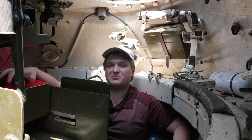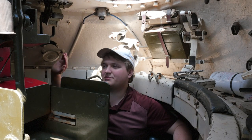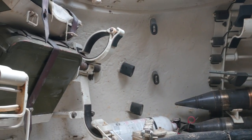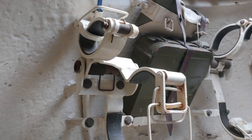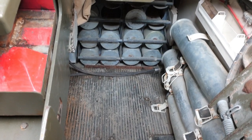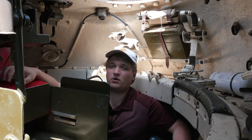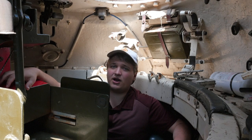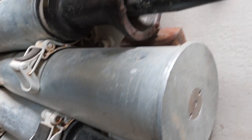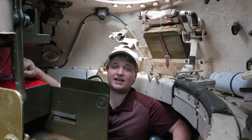Here I am in the loader's position and his duty was to load the main weapon. To my left and rear, as well as my rear right down in the hull, there are mounted racks of ready-use ammunition used to achieve the seven rounds per minute average by T-54 loaders. As well as in the hull, in the front of the vehicle, there is a rack of 25 extra rounds of ammunition. The problem with that is that the way it's mounted, you can't access it if the turret is anything but facing direct forward. The types of ammo carried in this vehicle would have been high-explosive fragmentation as well as armor-piercing discarding sabot. Further variants of the vehicle would carry, as well, armor-piercing fin-stabilized discarding sabot and anti-tank guided missiles.